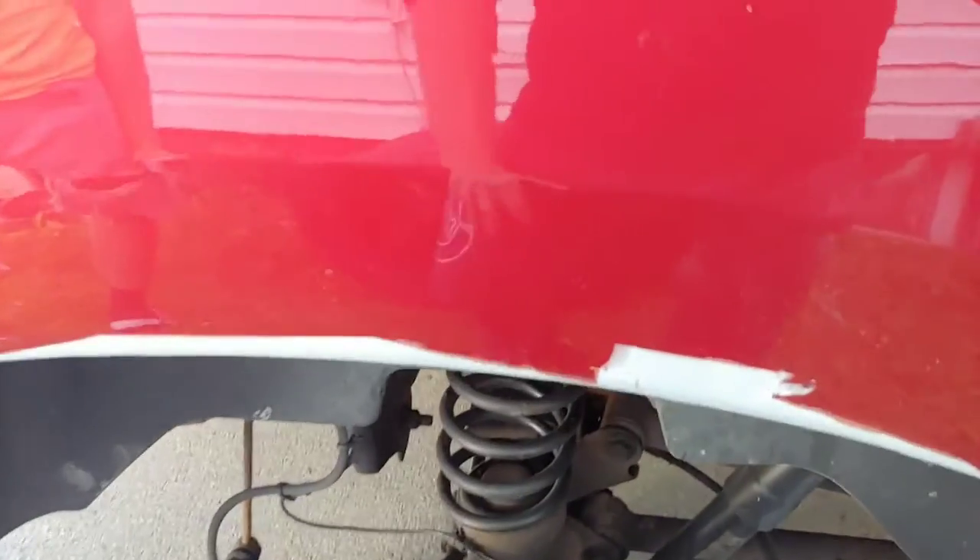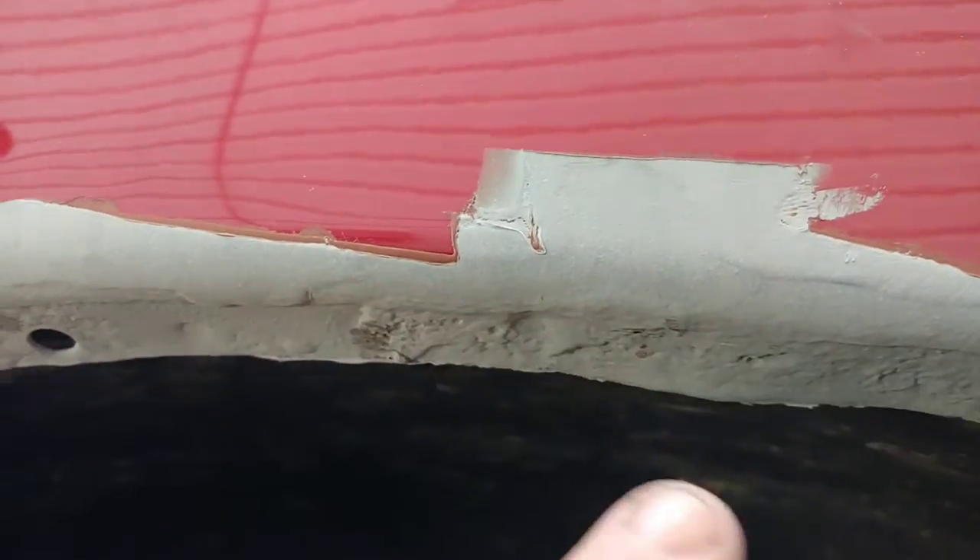The reason I'm putting them on is because my truck started to rust right here and went all the way to here. So I removed all the rust, sprayed a special base coat — it's like a brown rust protector underneath — and then I spray this on top of it. Hopefully it doesn't rust anymore, or at least prevents it for a while.